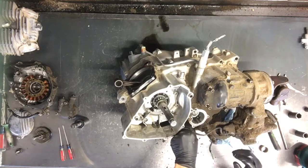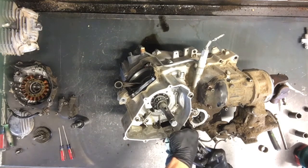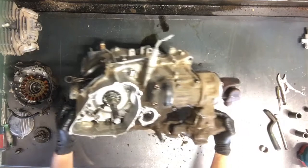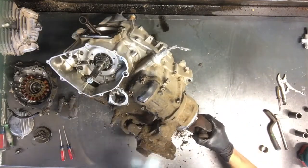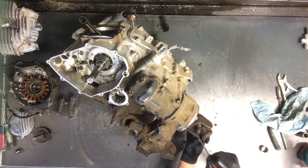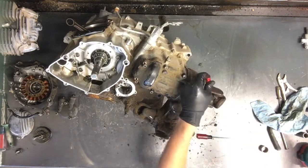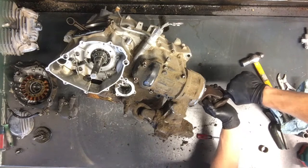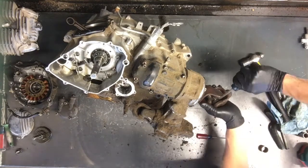There's your oil filter here — never want to reuse an oil filter, so we just throw that away. There's a sensor here; we'll use some pliers to pull that off — it's just a cap on the sensor. Then we will pull the middle gear apart and the yokes. For the first yoke, we'll do the back one. I grab two screwdrivers the same length and find the keeper. There's one right here — we're going to do the yoke that's attached to the motor. We'll tap that keeper, and then take a screwdriver in behind there and pry it out — it'll go flying if you don't put your hand behind there to catch it.